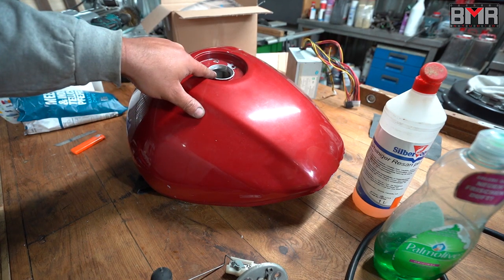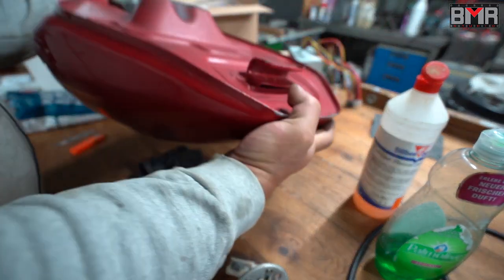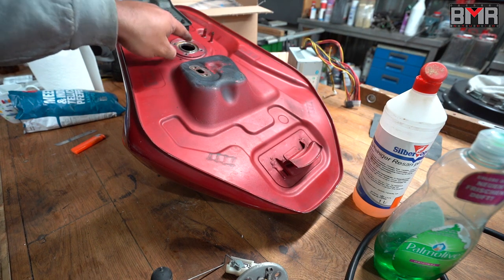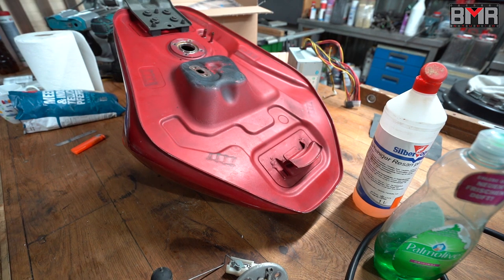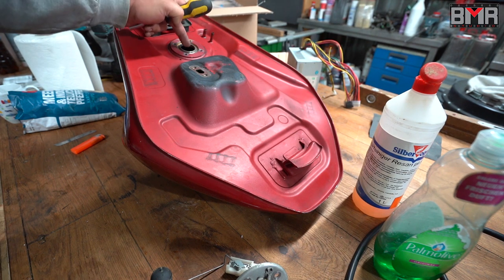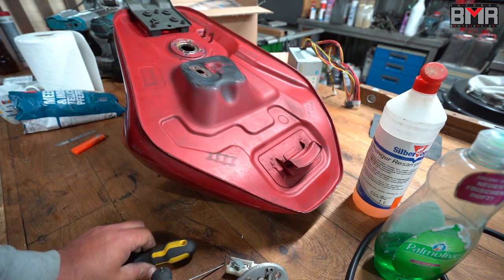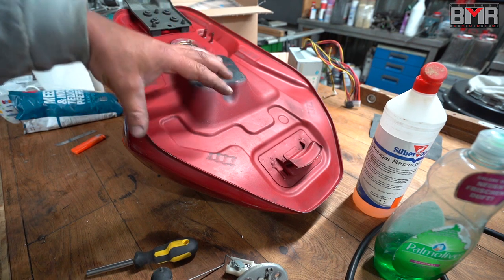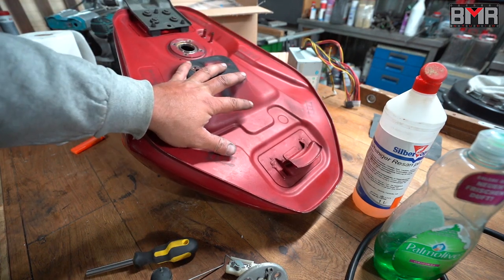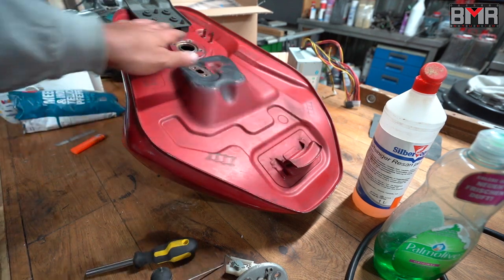Then release the water and mixture from your tank. Find some cloth or rubber to cover the outside, then wash with your high-pressure washer and close this hole. Try to keep the nozzle pointing here, because the high-pressure, high-speed water will also grab a lot of air inside. These bubbles and this large amount of air, water, and chemical mixture will do a lot of movement inside the tank — these small bubbles act like tiny explosions, so they will remove everything from everywhere.